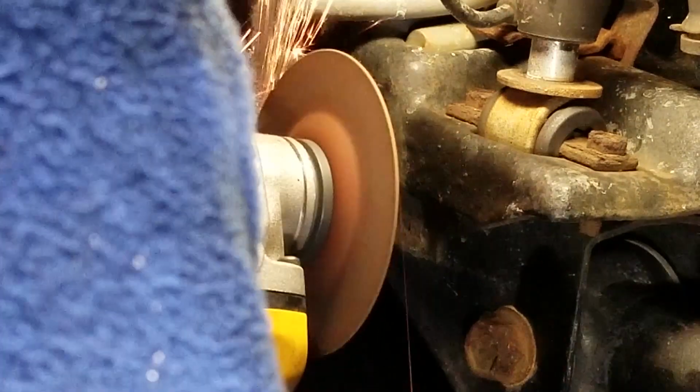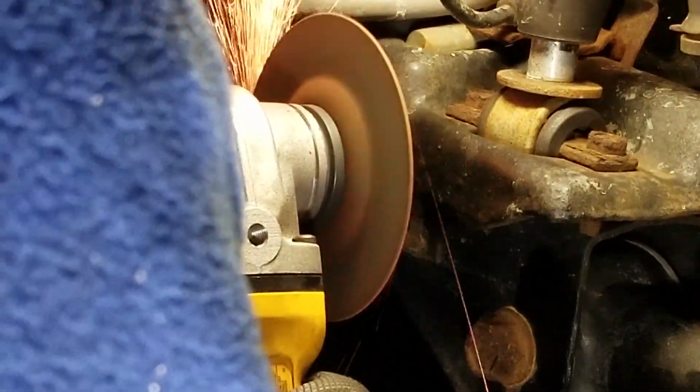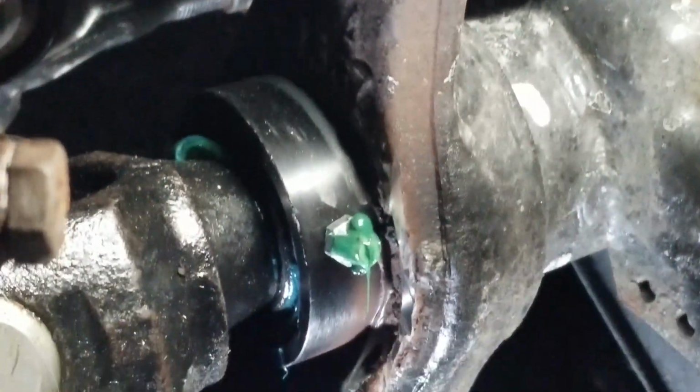some clearancing too. Now I might have known this would have been an issue if this came with some instructions, but it didn't. If I were to do it all over again, I would have clearanced this out before I put in the axle tube seals. So when you guys try this, I strongly recommend you grind it down about 1/16 of an inch.